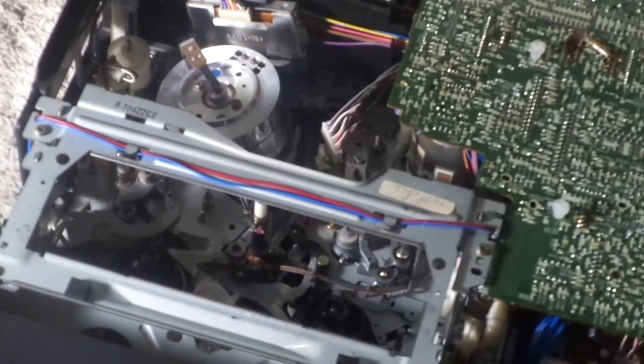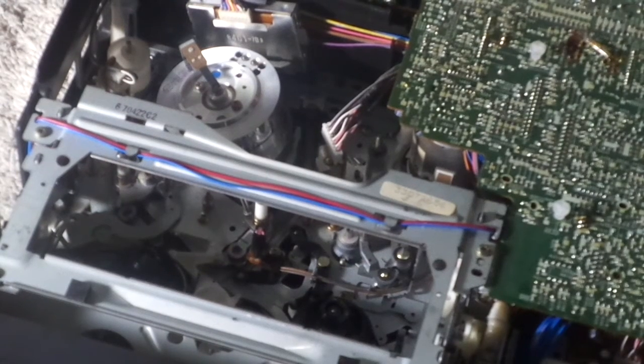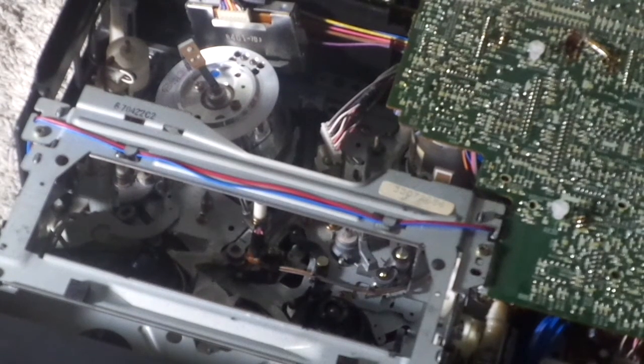So I hope you learned something new today. And if your old VCR from the 80s or 90s is eating your tapes, this is most likely the problem — a worn out belt like this. Sometimes in worst cases, belts could be completely worn out and could turn into goo or liquid — just gooey. And it's really hard to get off your skin.